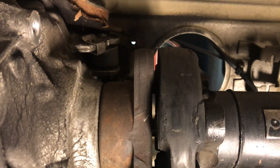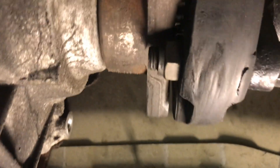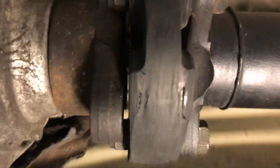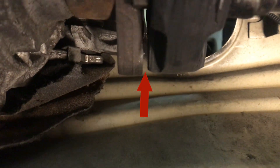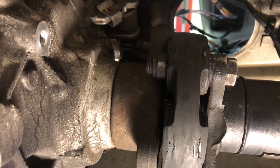Now the driveline is aligned perfectly. We spin it around slowly to see the distances, and you'll see very, very similar distance all the way around and up to the other side of the vehicle. This is all to be measured with a micrometer to make sure all the distances are exactly the same. But once it's set, start fabricating your transmission and engine mounts and install.